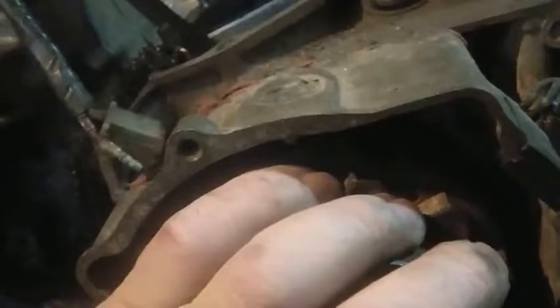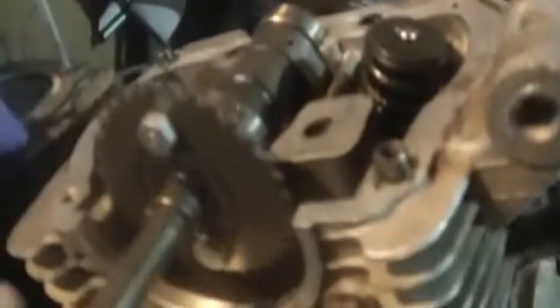Now notice the F mark. To get to the F mark you have to turn the flywheel backwards just a little bit. By turning it backwards, you're moving the firing to just before top dead center, because it takes a moment for the gasoline to explode and send the piston downward. You don't want the piston to already be past top dead center when it fires — you'd lose part of the power stroke. You want the full detonation to hit just as the piston crosses top dead center. If it fires before that, you get pinging because the piston has to fight the explosion on the way up.